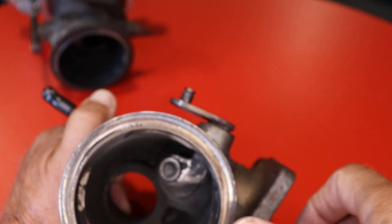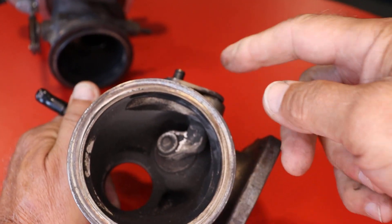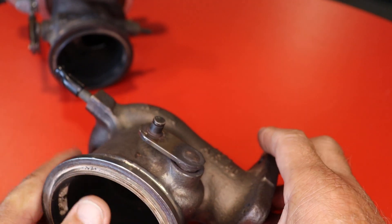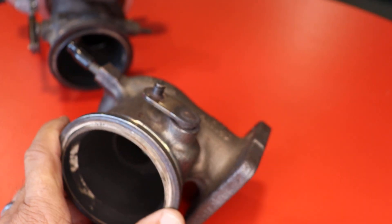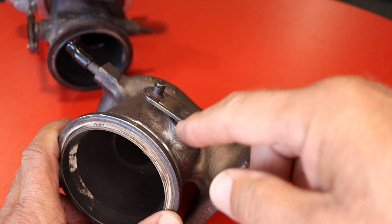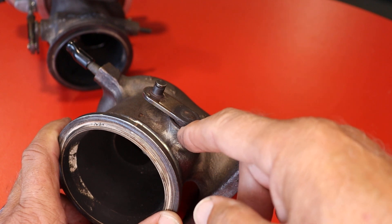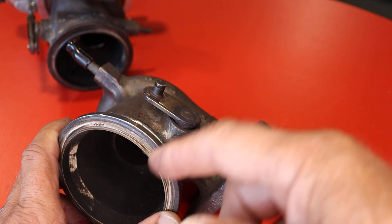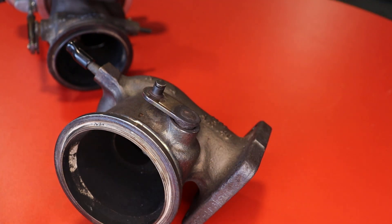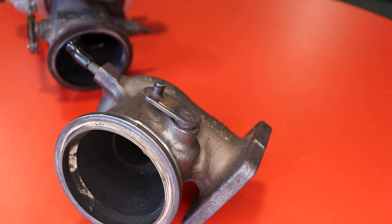Can you replace this? The answer is yes. You can buy this part for about $60, but you can't do this at home — you have to take it to a machine shop. They grind this off, take this lever off, put in a new one, press out the bushing, put the new one back in, put this back on, make sure you get it in the right place, and weld it on. It's about $300 and some odd dollars worth of work.